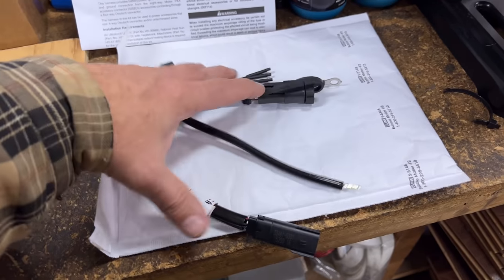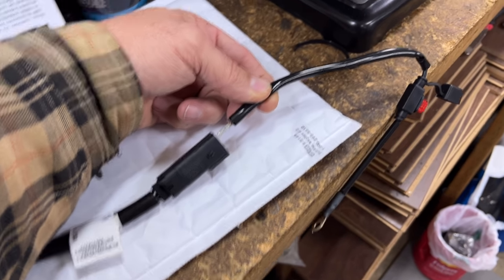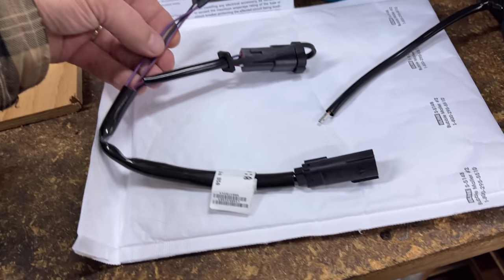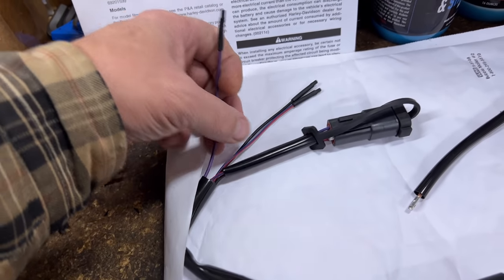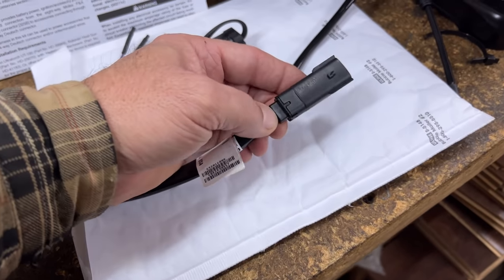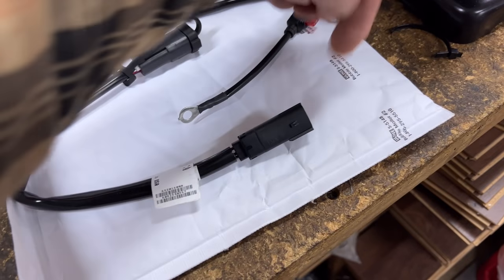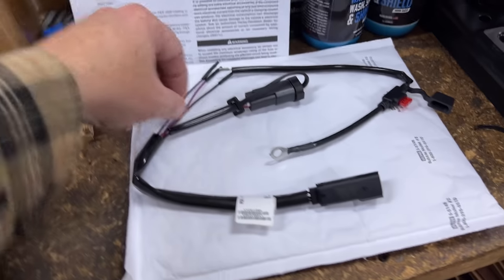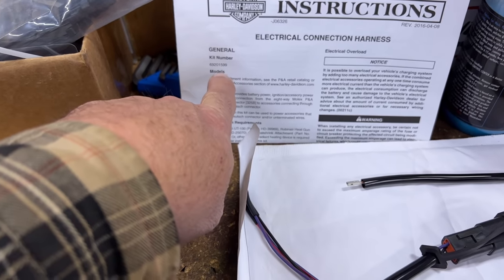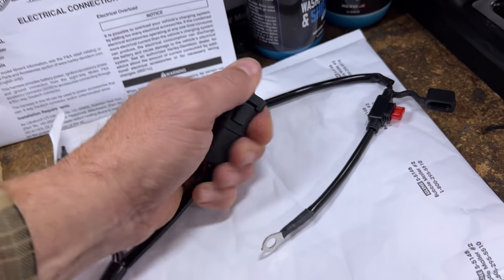This will connect directly to the battery, and when you plug this in it goes into a ground. The coupler here - you're going to add this 12 volt to it, directly off the positive side of the battery, so it's 12 volt constant. Depending on where you plug it in, it's whether it's keyed or not. You have the lavender with blue that's keyed hot, the red with a blue line is hot all the time, and the black is ground. The only thing missing at this point is the 12 volt hot all the time, which gets added to the coupler in the wiring harness. There's another coupler with the version A of this kit - a smaller coupler instead of this four-pin Deutsch type connector.